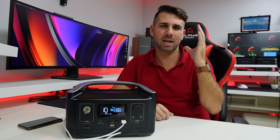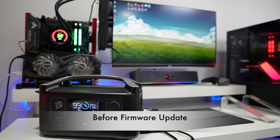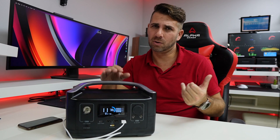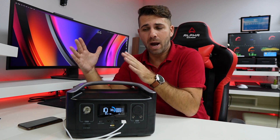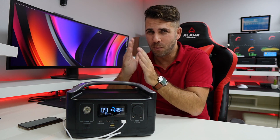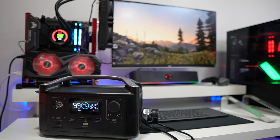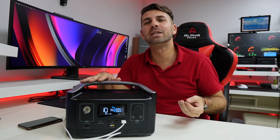I did play around at the picnic and at the beach. In terms of power consumption: a desktop computer at idle — including a 4K LG display and an RTX 3060 Ti — consumes roughly 130 watts idle. With 288 watt-hours total and consuming 130 watts per hour, you get roughly two hours. If I play a game it ramps up to 270 watts on the desktop plus monitor, so that gives only about one hour before it's dead.